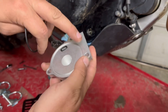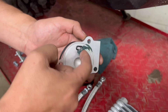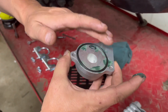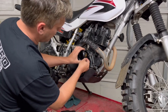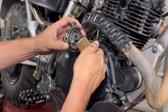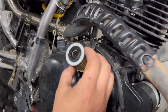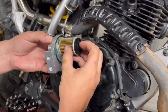If the O-rings tend to fall out, you might put some grease in here to help hold the O-ring. Now the O-ring will stay. We're going to remove the OEM oil filter housing cover and remove the filter. Remember that the hole goes out away from the motor. Because your new one doesn't have that little peg, just make sure we put it back in the same way.